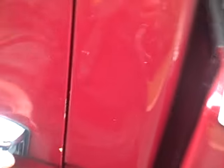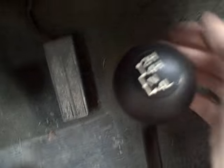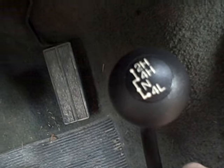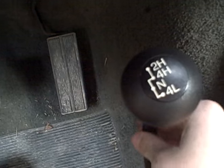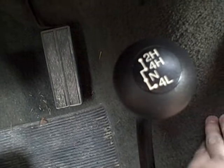So what four-wheel drive means is that all four wheels work together — all four turn to drive wheels, which drive your car. The only time I use four-wheel drive ever is really when I'm off-roading, which is almost never, or in the snow, which is sometimes. Four high — technically you can take this vehicle at the same speeds in four high as you could in two high, which means city, highway, anything. But if you're in four high on the road, you're probably in snow and you don't want to be driving fast. So I really recommend if you're in four high to slow down.